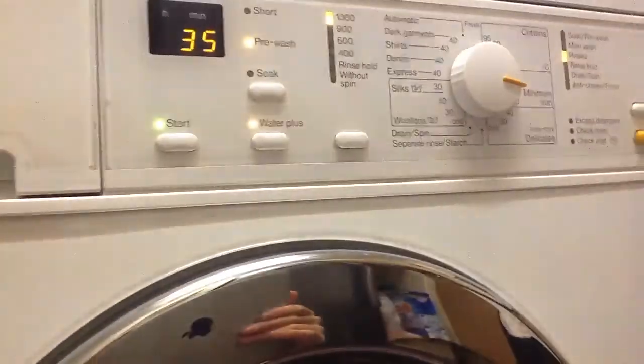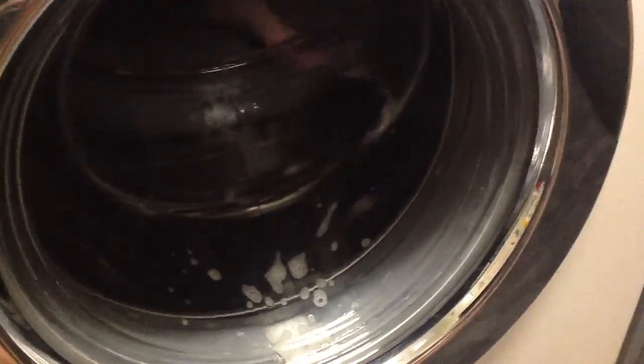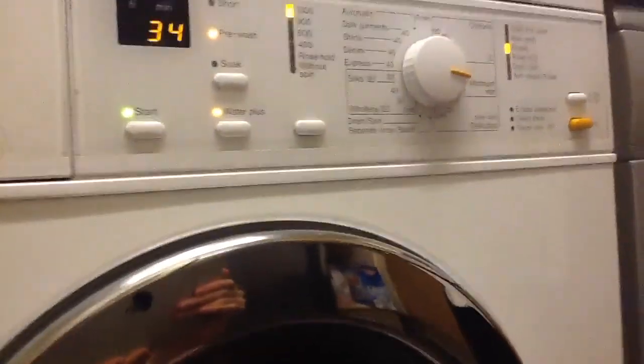There's a reason I use Water Plus here — so that we have an extra rinse. User Miele Touchtronic Deluxe was asking what the Water Plus option does. On Miele machines, the machine is sold with the default setting of an extra rinse, but I've programmed mine to do an extra rinse plus top up the water level in the main wash — and I think on the rinses too. The final rinse I think it does, but it all depends on load size.